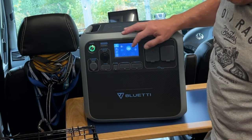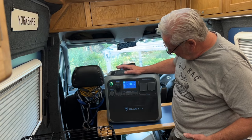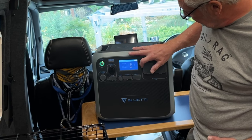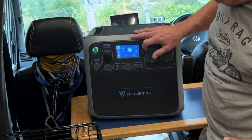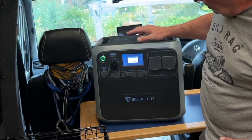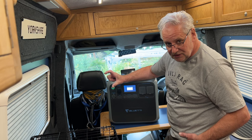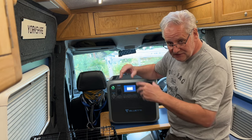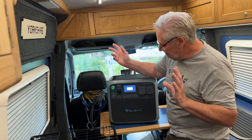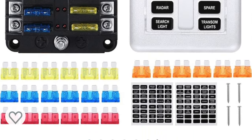There's all the settings - you can transfer it between different hertz settings, move it from eco mode; it's got lots of different functions. The simple thing is you just press it to switch on your AC and your DC which are on the bottom. So if you're fitting this into your camper van, you'd put a lead into here - the lead you buy from Bluetti separately - and that could go to a distribution fuse box. From that fuse box you'd run all your 12-volt system in your camper van, line up all your cables, put your lights in, any USB sockets, anything else you want at 12 volts, and that connects to a standard fuse box which you normally have in a camper van, then plug into here.